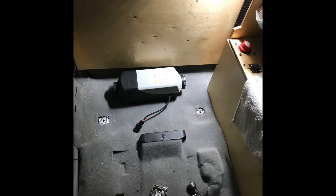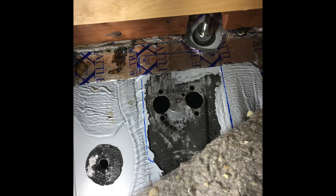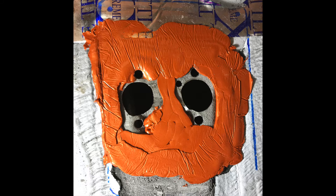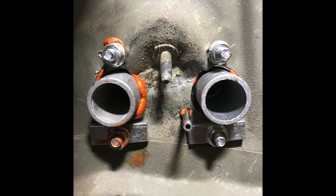The heater is directly behind the front passenger seat. The floor is a little bit uneven here, so I removed the floor covering, ground it down a bit, then put some Permatex high temperature silicone on there. I used saran wrap and the mounting plate to make it flat, built it up level with another layer, put a final coat of sealer, and glued it down. I used wide pieces of metal to get a good flat surface to bolt it down to the floor.